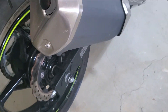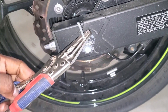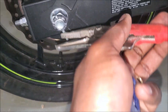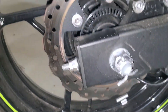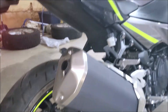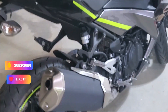That's how you would adjust the chain tensioning on a Kawasaki Ninja. And finally, don't forget the cotter pin — you can ideally use a new one, but I'm just reusing the old one. Put it in and make sure you bend it in two different directions so that the pin doesn't come out. The cotter pin is in the castle nut and everything is tightened. The chain is in the right tension. That is how you would adjust the tensioning on a loose chain in a Kawasaki Ninja 400, 650, or any of the other Kawasakis as well. There you have it — I will see you in the next video.